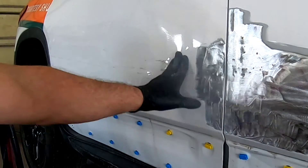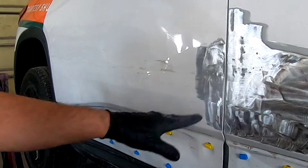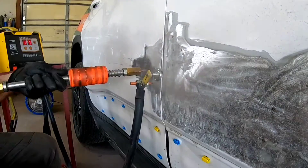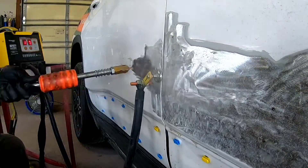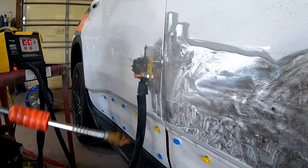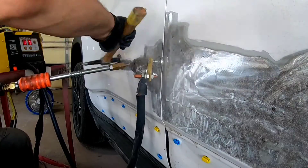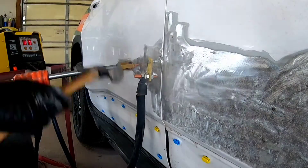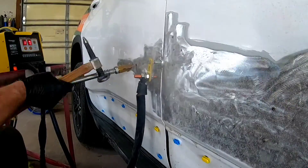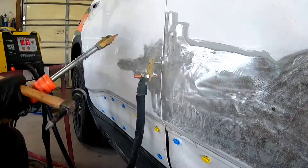Now I'll start removing the crease in the rear door. We want to pull out the center of this damage and tap down the crowns around it. We'll need to grind it down to bare metal and then get the G90E and start pulling out this door. This type of damage will stretch this metal, so we're trying to pull it out without stretching it any more than we have to and get it back into its shape. You may have to shrink this metal before you start laying filler in it, and we will be showing you how to do that later on in this video.